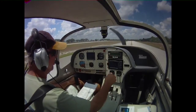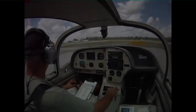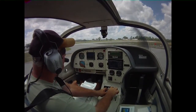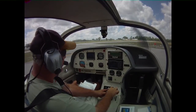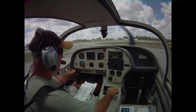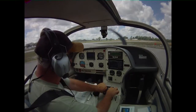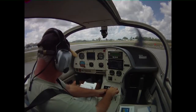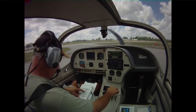I don't like to take off until I'm above 200 on my cylinder head temperatures — this is the highest cylinder head temperature reading. We'll get her up to 1,600 RPM — 1,580 — quick mag check. Note there's no drop. Mag check's good. Prop is fixed pitch.